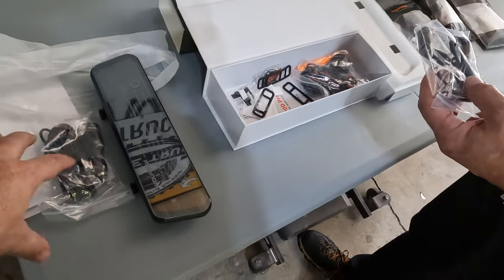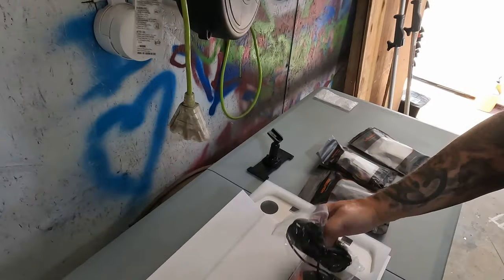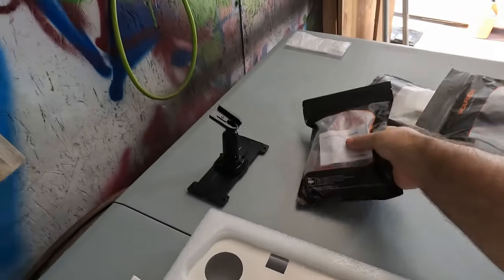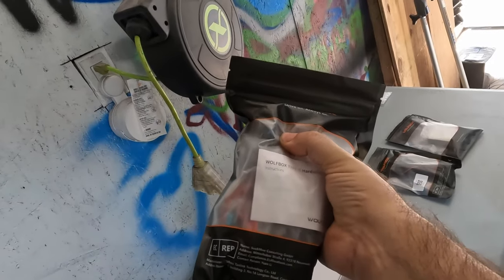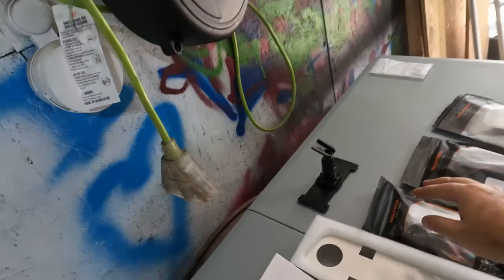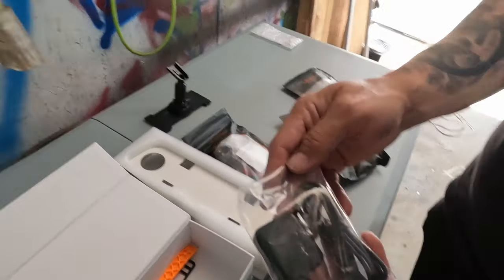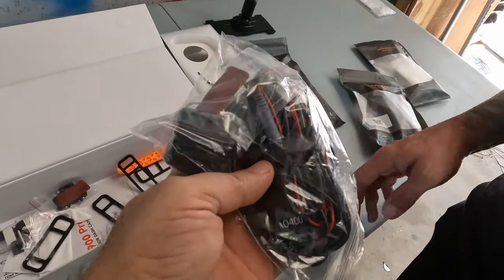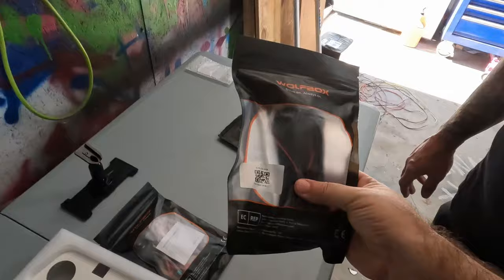Here's the forward-facing camera. If you don't want to change them out, there are straps that wrap around to the OEM mirror and just strap right on there — those straps are probably included in the box. There's the power source — plugs into any 12-volt outlet for power. If you don't want the wire hanging out, there's an included hardwire kit that lets you tuck the wires behind, with a fuse tap to go down to your fuse box panel. It also has a GPS antenna.